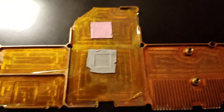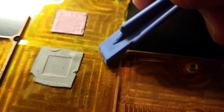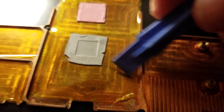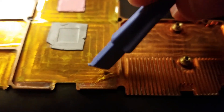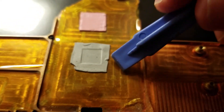So first off, they just have this little bullshit tape here. The thing is, they were trying to protect and insulate the copper from touching anything, so you can see this little film right here. The only thing is the film covers the entire thing — they have this thermal tape on top of this tape, so all of the thermal energy is getting sapped up by this. I've got to remove this to get to the bare metal, and then put the shim on top of that.